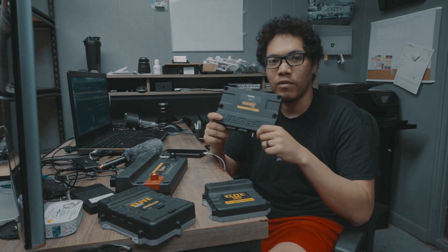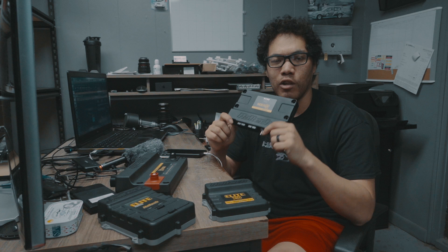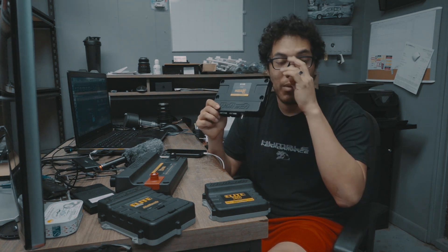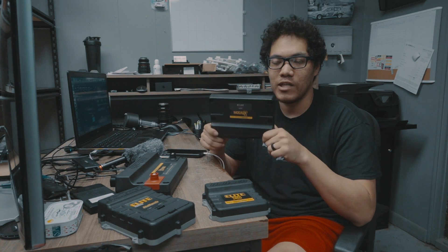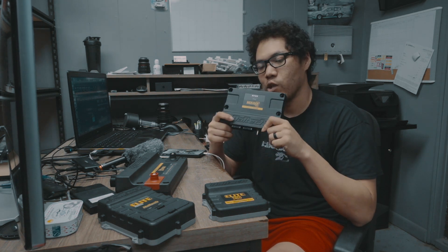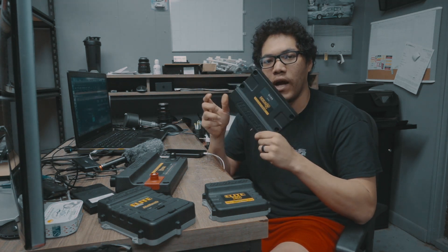With the Nexus I'm able to data log literally every single channel at much faster speeds for hours — up to 500 channels. I can monitor every vital in the engine. If I'm doing a track day, I can pull all the data from that session and find all the issues. Whereas with the Elite 750 or 550, you're really limited to that 10–15 minute window. So if you're running anything beyond a couple of pulls, this is going to be beneficial because you can actually see all the data you need, with a lot more I/O for sensors and engine health monitoring.